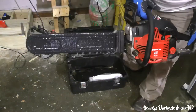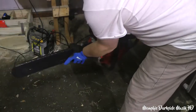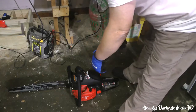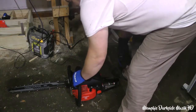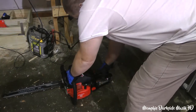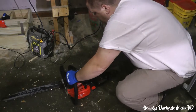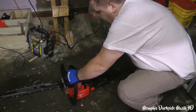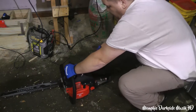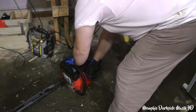I forgot to bring it in. Let me get that off and make sure that's good. You got a primer bulb — press that ten times. You have a choke — pull that out. Will it start? You got to pull this here five times.